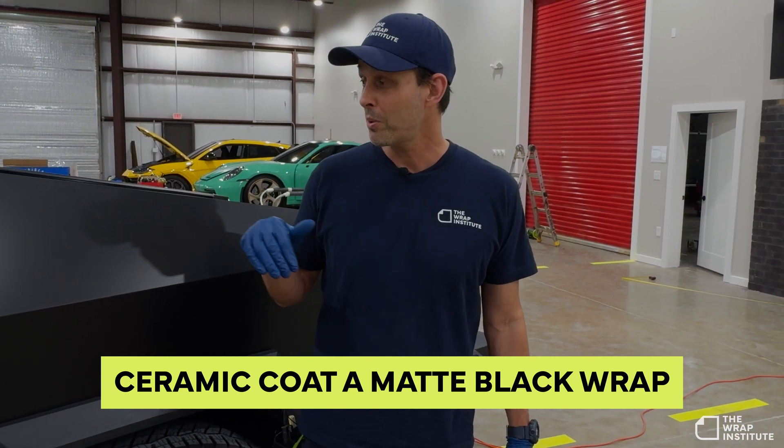Now I'm ready to apply the coating. Use a nice foam applicator. This is a big section — the back fender of the Cybertruck, the bed area — so you want to put a lot of product on here. I juice it up from side to side and fold the applicator so it's nice and even. The protocol is important: I do a squiggle in the middle section first, then I frame it 360 degrees around the outside. The squiggle puts the first run of product in the center so the applicator picks up excess and doesn't run dry side to side, and framing the edges first means when I go top to bottom with overlapping strokes I don't have to worry about running short on the edges.